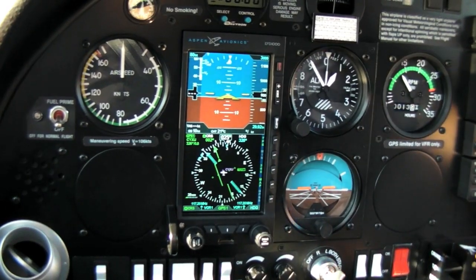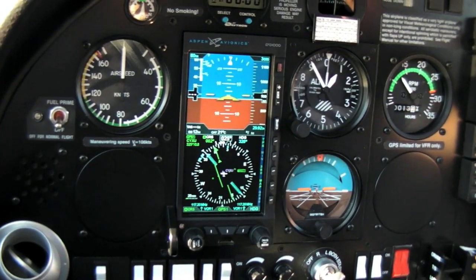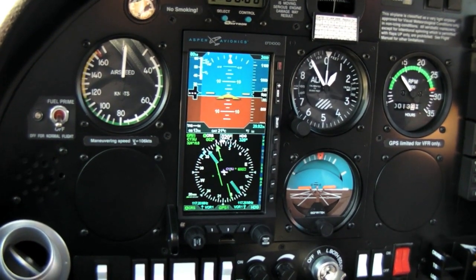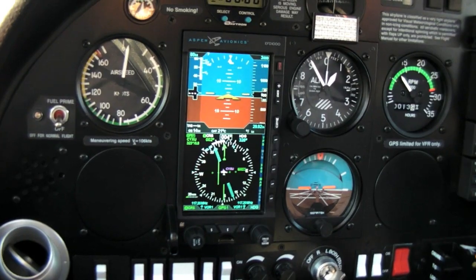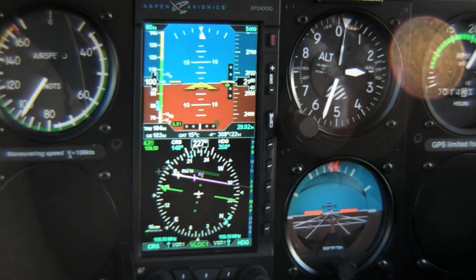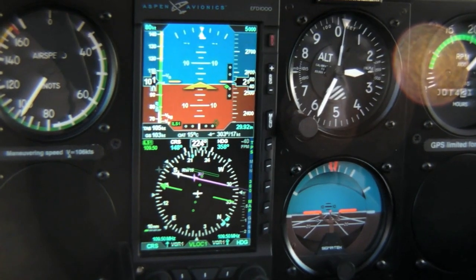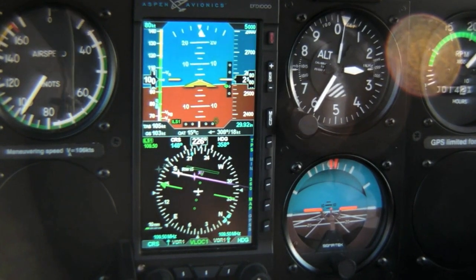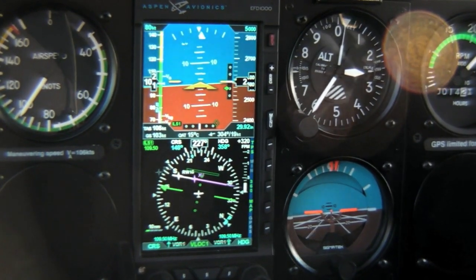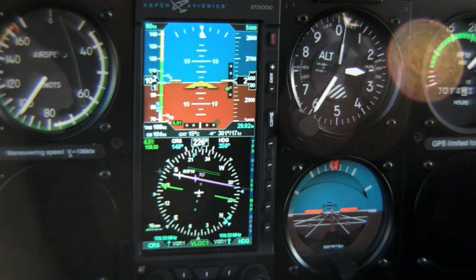Because of its small cabin size in the DA-20, the display is just the right distance from the pilot's eyeballs, so it's more readable than it might be in larger aircraft. During our trial flight, we did some maneuvering and navigation, including an ILS back into London. Between the GNS 430 and the Aspen displays, instrument approaches are about as simple as it gets. In this clip, you can see how the Aspen displays both course guidance and glide slope on an ILS.